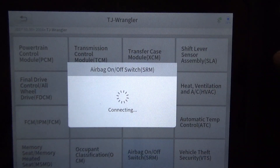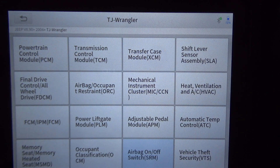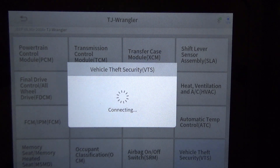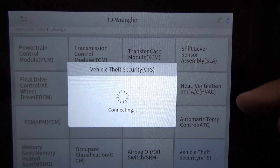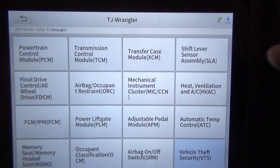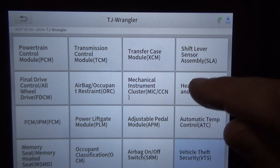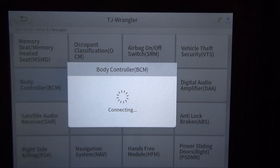They may have deactivated the airbag system — it's got an aftermarket bumper front and back with a lot of off-road equipment. They may have also deactivated the ABS brakes so they lock up properly off-road. Whatever modules we can connect to, we'll see what activation tests and special functions they have. Even when we get a no-response, it gives you an idea of what other Jeeps — like a Grand Cherokee — might have that the scan tool could connect to and help troubleshoot.